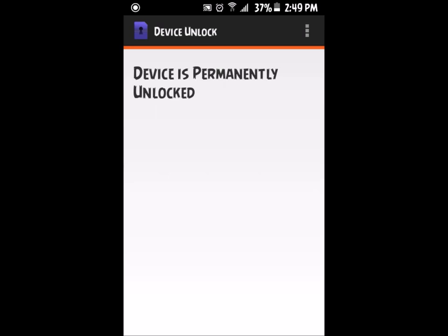From there, turn off the phone. If the SIM card is in the battery compartment, take out the battery and pull out the SIM card. If the SIM card is on the side of the phone, just take it out. Then take the second old SIM card from the other old phone, put it in, and turn on the phone.